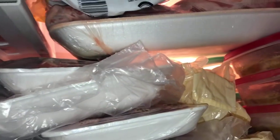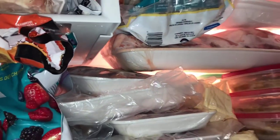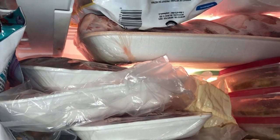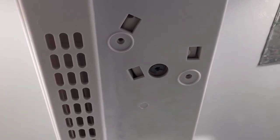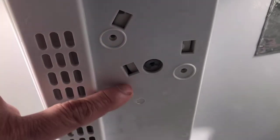When you put a lot of food in the freezer compartment, there should not be any ice build-up on the back panel. So if you start to have a lot of ice build-up on the bottom, that's an indication that the defrost is not working. If you have a problem with ice build-up in your freezer compartment and there's no cold air into the fridge, you'll likely have a problem with the defrost timer.